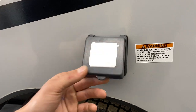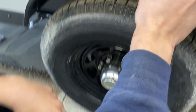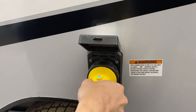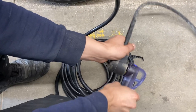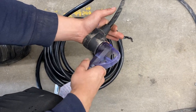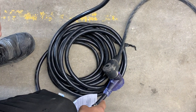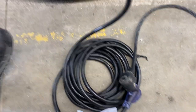A step back and you'll find your power port. Open it up, line up the notch in the bottom corner with the notch on the port, press it in, give it a little eighth turn to lock it in place, then use the threaded collar to really lock it down. Following the cord back you'll find a standard 30-amp end — most campsites have that so you can plug straight in. We also provide a 15-amp adapter so you can plug in at home to charge your batteries or run your fridge.